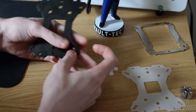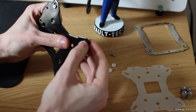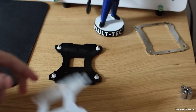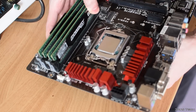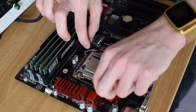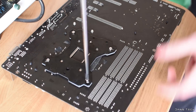Moving on to the installation run-down. To get started you'll want to prep the backplate by placing 4 screws through the appropriate holes then placing the non-conductor film on top. After you've done this you can then push the washers on top of the screws. To install this onto your motherboard, you'll want to place the backplate on your board and then screw 4 nuts onto the screws by hand. After this you'll want to flip the motherboard upside down and screw them down tightly with the provided screwdriver.